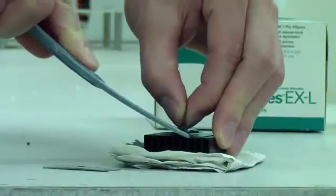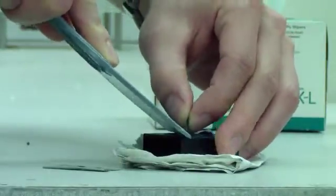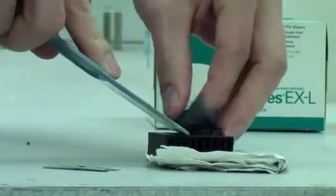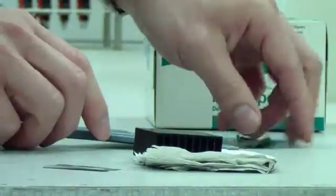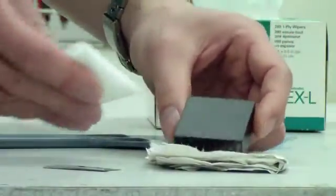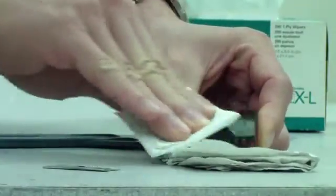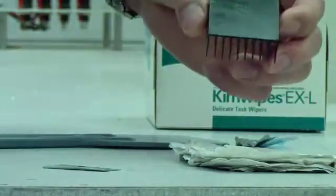Notice that we put this heat sink on a little piece of paper towel, and that's just to protect the fins of the heat sink a little bit and try to prevent them from getting scraped. If you continue to work at it from different angles, eventually you can get the TIM off. And if you have residue left over, you can use a lint-free cloth and some kind of solvent — in this case isopropyl alcohol — something that's not going to damage the finish on the heat sink. Just use that to wipe it clean, and you may have to repeat this several times until you get everything off. And there you go — you have a clean surface.